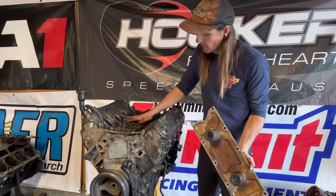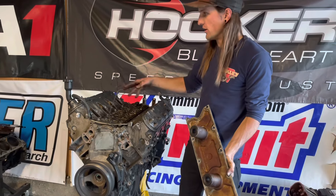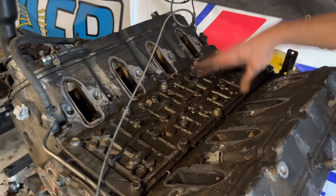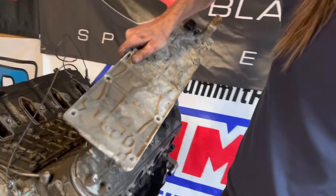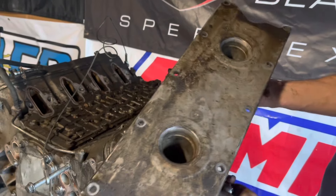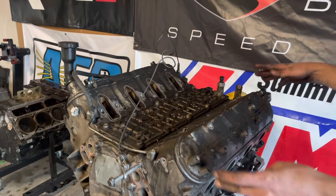Alright, let me just start cracking on this thing. The reason why this needs to get torn down — a lot of these you don't really have to open them up, but if you look at this valley pan, this is an active fuel management motor. It is the first one — that's the cylinder deactivation. Here is a 2008 valley pan — same thing — and then you've got the old valley pan with nothing at all. And then you've got your knock sensors here.